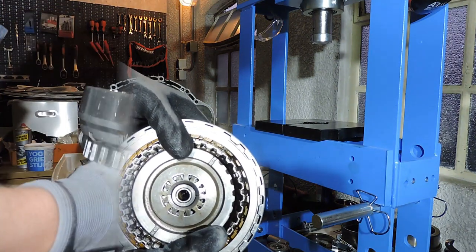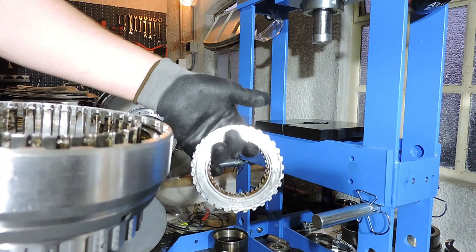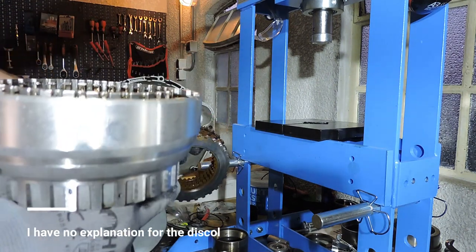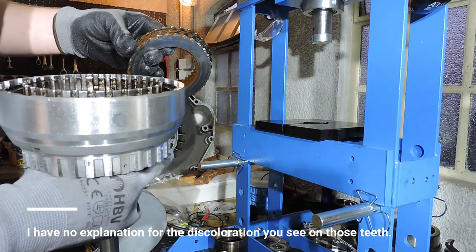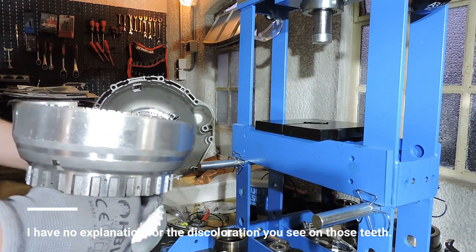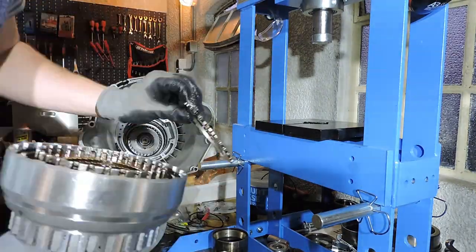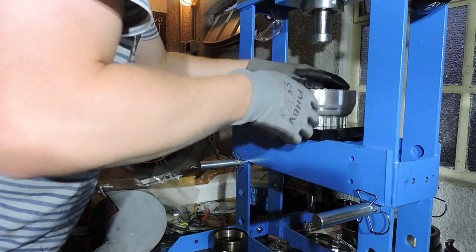So this is what we're looking at. And we still have that clutch pack here with those very thick frictions. I mean, the diameters are small, but to make sure you have enough surface for the torque, they just made these really thick packs. And from what I can see, this pack does not have a wave plate. So I guess it goes in without a wave plate. So let's reassemble it. The inside of the drum. There we go. Almost there. That's the snap ring right there.